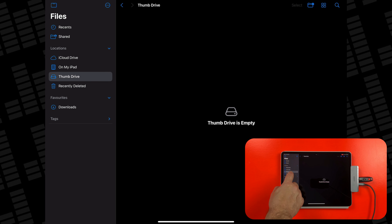If you've bought a new external drive or want to use an existing one with your iPad, it's important that you have it set up with the correct format. You can erase and format a drive from the iPad itself, and the process is actually really straightforward. Attach your drive to your iPad, open the Files app, then in the Locations section of the sidebar, press and hold on your attached external drive. In the menu that pops up, hit Erase. When you do this, it will delete absolutely everything that you may currently have on that drive. In the next menu, you can choose to rename your drive and select from three formats that the drive will use once erased.